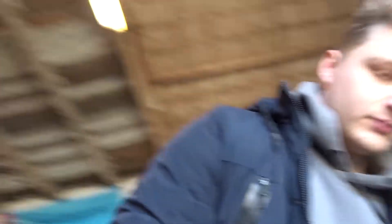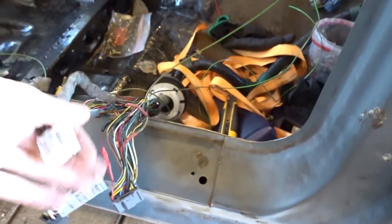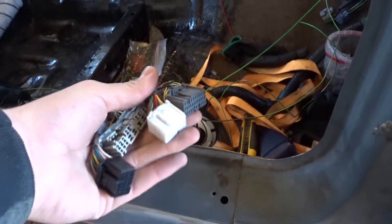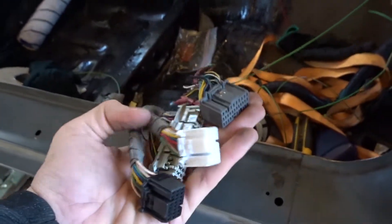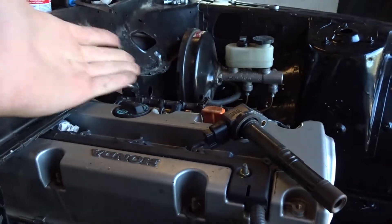You do need the original engine wiring harness. It's the part that goes to the ECU — it's the one with these cables. I have an automatic wiring loom, so I have to probably cut some wires and adjust something. So I have these plugs — let me show them real quick. These four. You probably have three if you don't have an automatic transmission from your K20. It's the one with the injectors and these things.